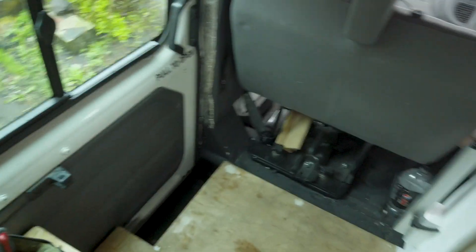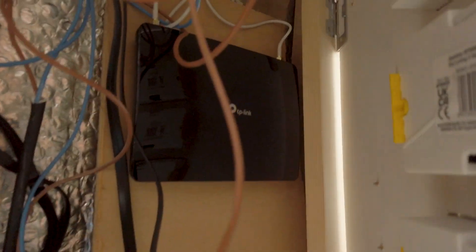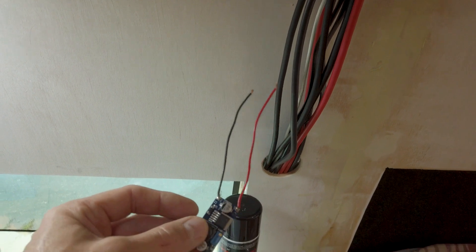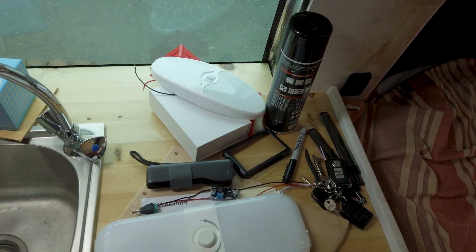Every time I open the door it's pouring in, it just won't stop. But I've got some wiring tidied up - ours are all wired in now on switches and the USBs are all wired in and working. His are all wired in and properly off the switch panel, so everything's switched and fused. I'm just getting the TP-link in, tidied that up and put a little backing board in for it. That door will still close once the wires are out of the way. I'm just going to wire the DC-to-DC in.